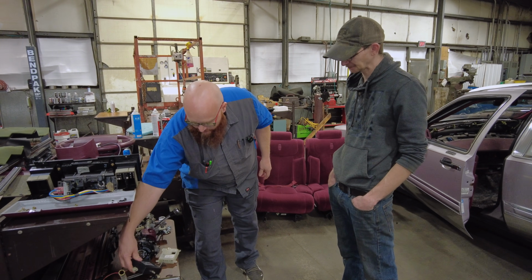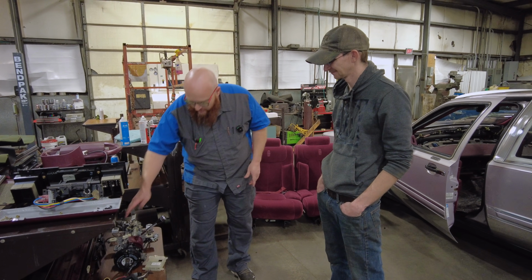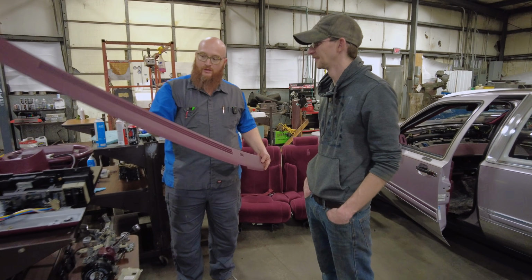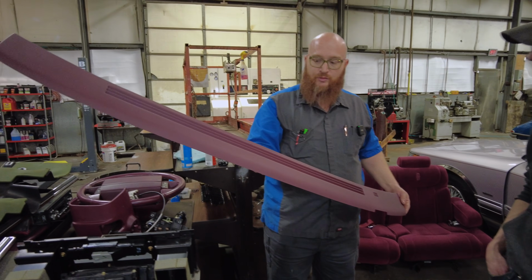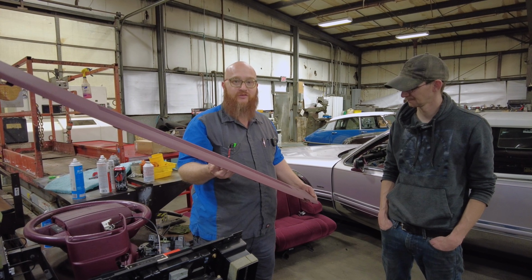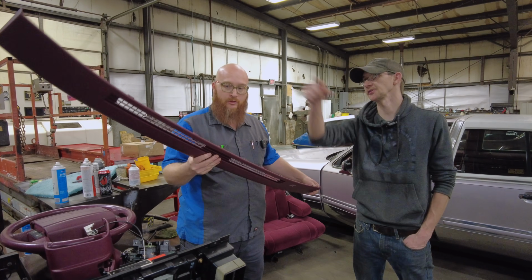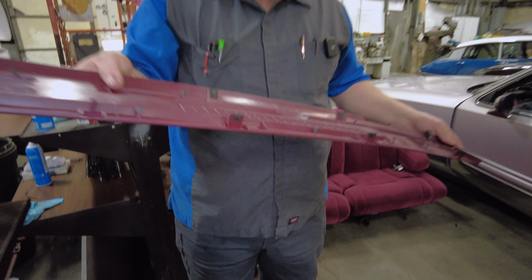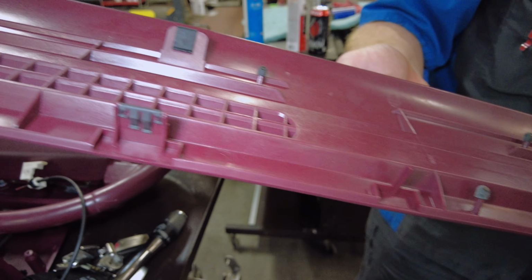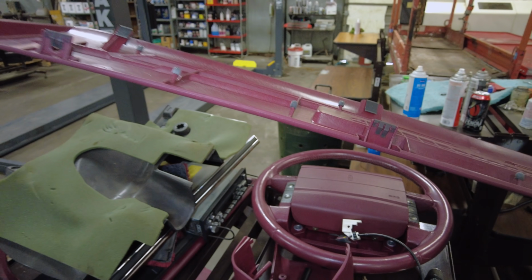Definitely. And then we come to the part that was the most stressful, difficult for you because you were scared to break it. Yep. Is this defrost panel. These are one of those parts, no matter how good of a mechanic you are, it just wants to break. It would love to snap in half on you. It's begging to. This thing's not held in with screws or anything. It's all tension clips on the bottom. Yep, all of these tension clips, and they can fight you pretty hard. You have to get a plastic little pry tool in there and slowly pry each one loose. I got insanely lucky with that one.